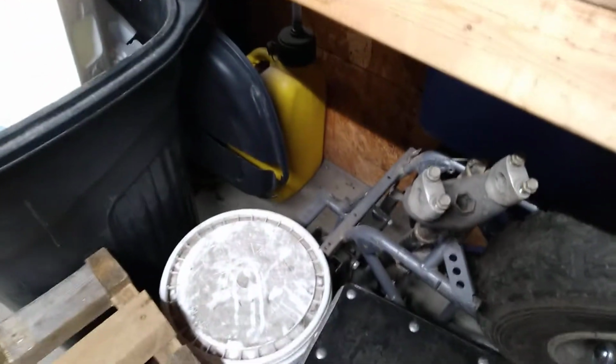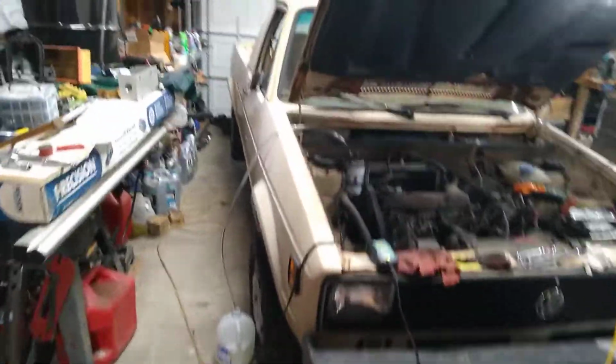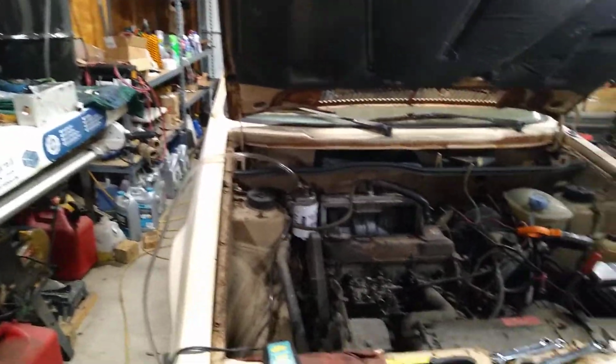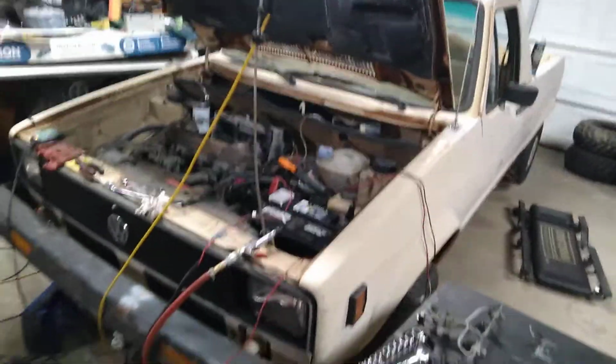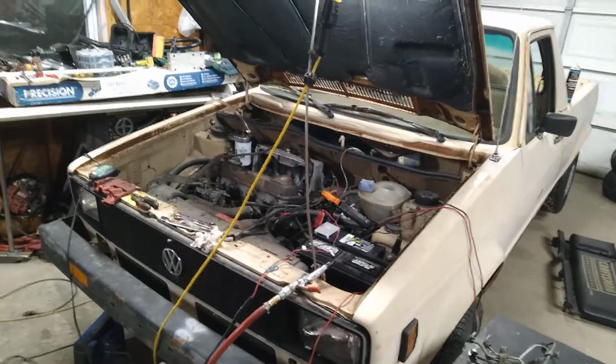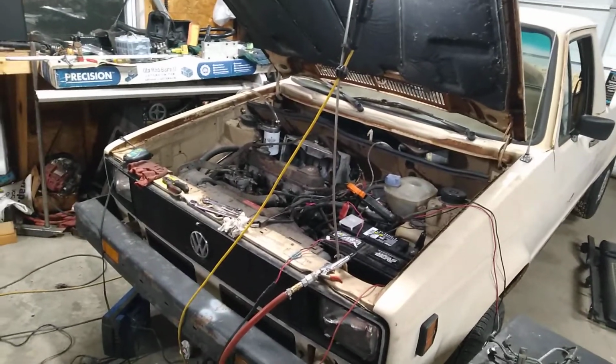There's a scale to measure out the potassium hydroxide, and that yellow container right there is 5 gallons of methanol. So you combine methanol and potassium hydroxide and some heat, and you stir it in a tank like that, and you can make your own biodiesel from waste vegetable oil from the local cafes. So I want to give that a shot, and if I'm spending $5,000 or $6,000 anyway, I might as well make this thing a usable little truck.